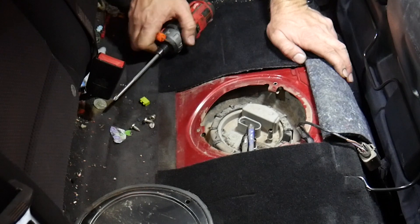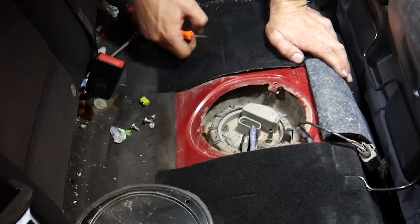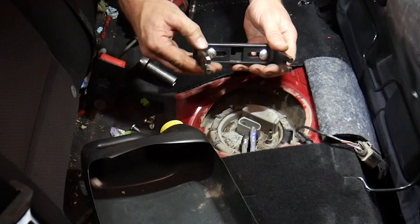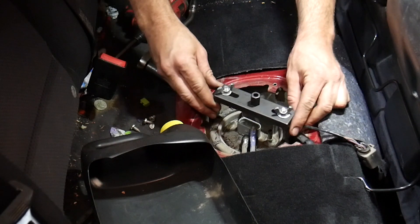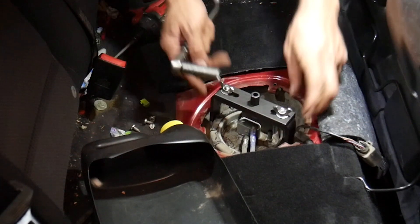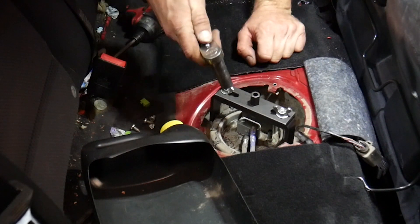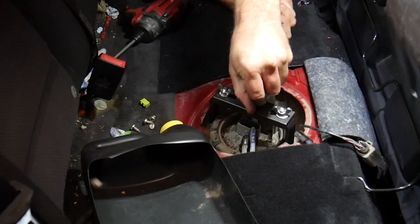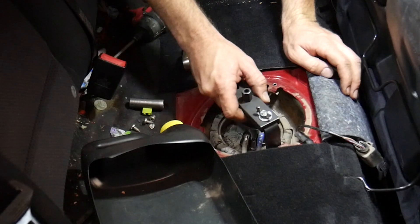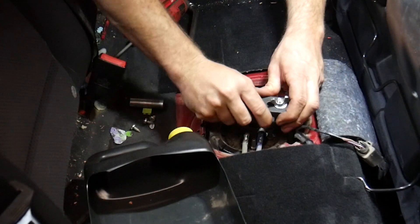Now we need to get this plastic ring loosened up. Some guys will use a chisel and a hammer, but I don't like doing that on the plastic ones unless I have to because it can break them. So this is an adjustable fuel pump wrench — this one's from Bluepoint. I will link a similar one down in the description below. You just adjust these two jaws until they fit snugly on the plastic ring. On these there are a couple of lips that are shorter than the other ones — you don't want to put the tool on those because you won't get a good grip. You can't spin this all the way around because the fuel lines are in the way, so once it's loose you can reposition it and keep doing this until that ring is loose enough to do by hand.